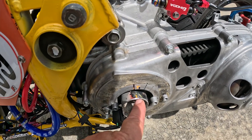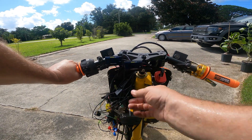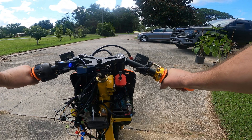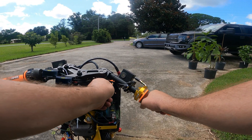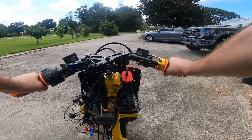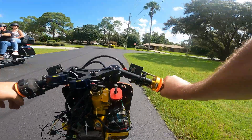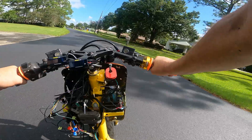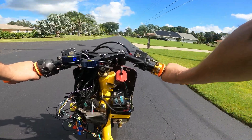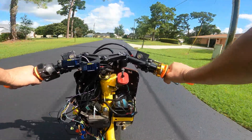The adjustments from here will be very minute — we're talking like a hair. The marks are pretty close. My temperature gauge quit working for no apparent reason, so I'm leaving the panel open to troubleshoot it. I still haven't hooked up the tachometer. The gas gauge is hanging down. Quite a bit of wiring still to do. When I turn a corner to the right hard, my key hits the handlebars and turns the bike off — that's crazy. But the brakes work great; you can't beat that. It still pops and backfires some — I don't know if that's carburetor or timing, maybe a little of both. But it runs real nice, handles nice, it's smooth, and the shocks work great. If I can get it running good, I'm pretty happy with it.